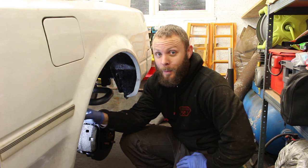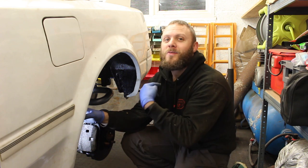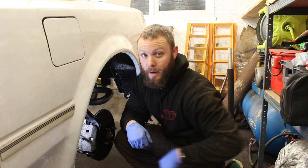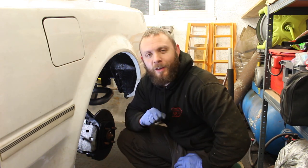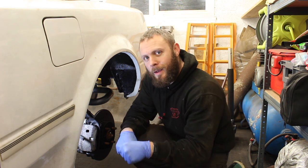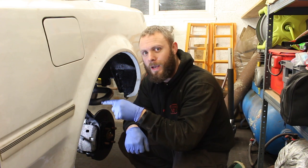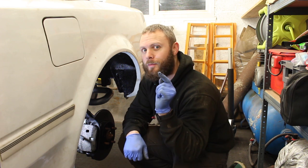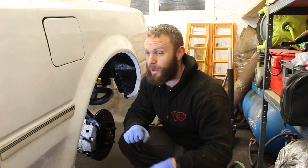It's now time to do the brakes. I'm starting the furthest away from the master cylinder, right over in the back corner. Same process: crack open the nipple, suck some fluid through until it goes lovely and golden, then whilst sucking close the nipple back up, check the brake pedal for feel, check for leaks. Then move to the other side at the back, then the front passenger's side, and we'll finish off at the front driver's side.